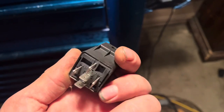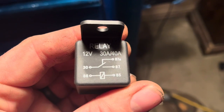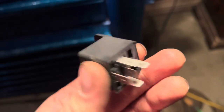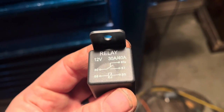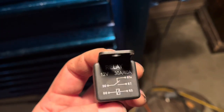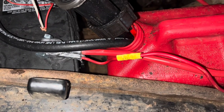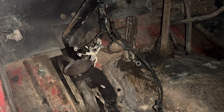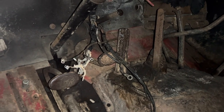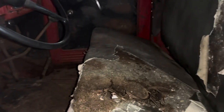Another key component of a job like this is the automotive relay. There are several different types. This is a changeover relay — you can tell because there on the diagram it says 87A and 87, and it shows the little switch that goes between the two. What this is is a high-amperage switch controlled by a low-amperage switch. That's great, because you can use it to turn on loads like your ignition, your fuel pump, and your headlights without burning up the little wires or the ancient switches in your vehicle. Important note: all splice connectors of this type need to be heat-shrinked. Previously preparing for this project, I stripped the engine compartment of this horrible, rotten cloth original wiring, and I really need to do the same to the dash — just get every bit of it out of here — but there's kind of a smell.